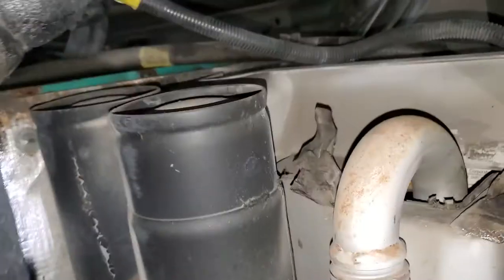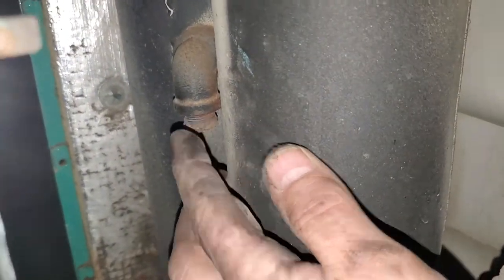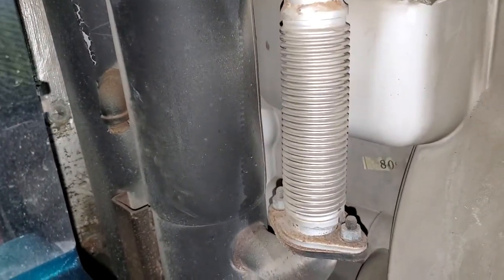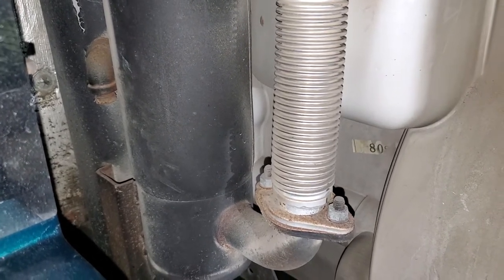All right, so remember I was telling you how you decarbonize your mufflers? Remember the exhaust comes out here, goes into this one, then it goes up to that one and out. Well, that's how you decarbonize. You pull that out, and you blow all that stuff out of there. You might think I'm kidding, but it does build up with soot. What's a diesel known for? Soot. And there's actually some on your gas generators. So please look into that, especially the old ones that get all carboned up.